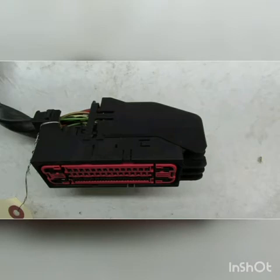So after scanning the car with the diagnostic device, it showed that there were some mixed up signals received by the ESP computer. So I decided to remove the ESP cover and clean it with the contact cleaner, which I guess solved the problem. But while trying to install this connector back, it broke.